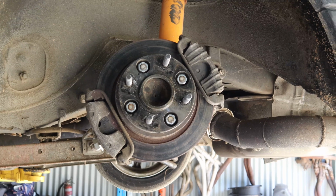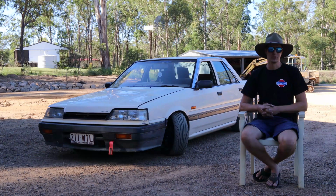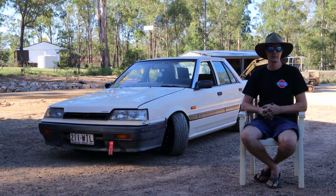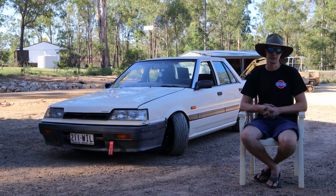On the rear end, running stock R31 brakes for foot brake. Also running dual caliper setup thanks to RB Factory caliper mounts. Also running VS Commodore handbrake calipers dedicated for the hydraulic handbrake. Running stock R31 caster arms, which thus far I've not had an issue with. The car self-steer is amazing. I run about 5 degrees toe out.